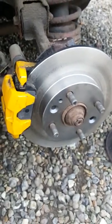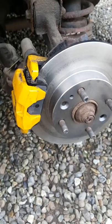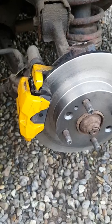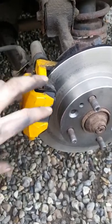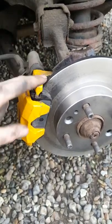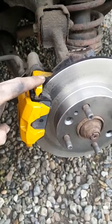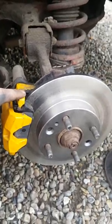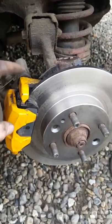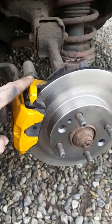And that's pretty much it guys — just make sure you take it out on the road and back. Check your handbrake as well. Another tip: before doing anything with the piston or taking it out with the Allen key, make sure you relieve the pressure in the line by removing the cap for the brake fluid reservoir under the bonnet. That allows the fluid to go somewhere once you're backing the piston out. But apart from that, thanks for watching guys, drive safe, and I'll see you soon.